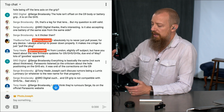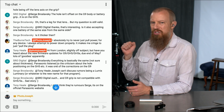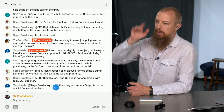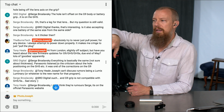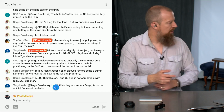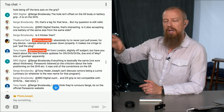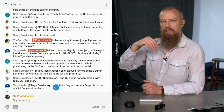But just a reminder, anything that you have set in the camera, any modes, any custom settings, anything, if you just yank the power by either popping the battery out or if it's connected to AC, just pulling it out of the wall, those settings will not be saved. You have to power the camera down. And I know this from experience because my close-up camera here and actually my above camera here are both old GH4s. And these are all plugged in, hardwired into the AC, all of which is on a system that I can turn on and off with a touch of a button. If I push this button, we go dark. We won't push that button. But it includes turning those cameras off. And so if I make a change to the camera, I need to remember to power the camera off and back on to save that. Otherwise, next time I boot up my room, those settings won't be there.